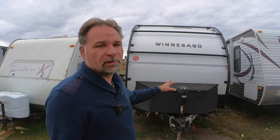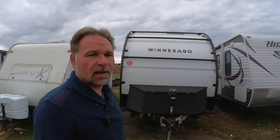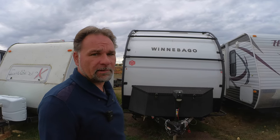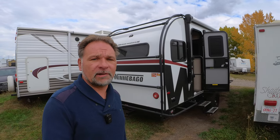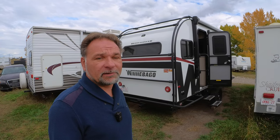One more thing you have to do before storing your trailer for winter in a cold climate — remove the batteries from your RV. I'm not taking them out yet because it's not that cold, and I want to do one more camping trip. I'll do that sometime in October and store them in my basement. You don't want to freeze your batteries — they're quite expensive to replace, especially six-volt or lithium batteries. It's a good idea to store them on a trickle charger. If you found this video helpful, hit the like button, comment below, and subscribe to the channel — I'll see you guys in the next video, cheers.